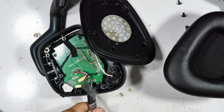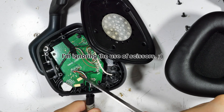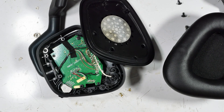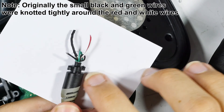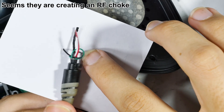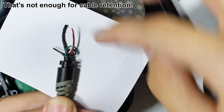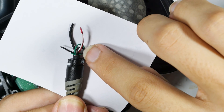They're being a little uncooperative, especially the big thick wire, but we're cutting them off — again leaving a little bit of color on the old wire so we can easily replace them. This is the old cable we just took out, and you can see that the thin black and the green wire wrap around the red and white. I think they're doing an RF choke, because that is certainly not enough for wire retention. The reason we bared off too little cable originally was we did not count on that wrap going around the red and white.